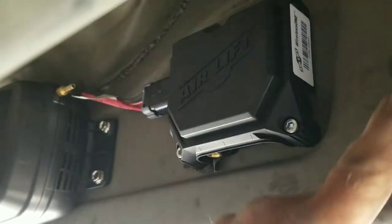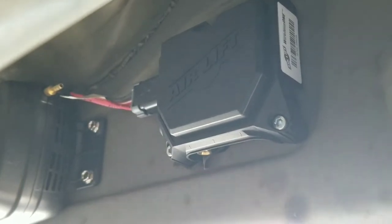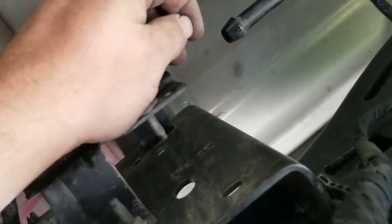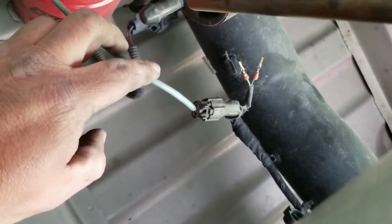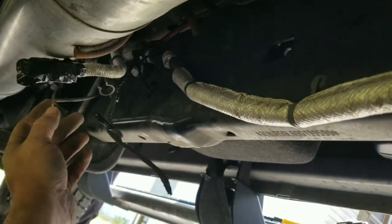There's one airline that will come off right here, and then this will be the airline that comes out and goes back to the bags. What I did want to show is one thing that's been taking so long: I've been taping up these wires. There's been some stuff removed off the truck and all these wires are kind of exposed. I wouldn't have done it that way myself — I don't want those two wires to get together as that can cause issues. Whoever did that should have taped it up, but that's the main thing that's been taking so long — all kinds of wires like that.